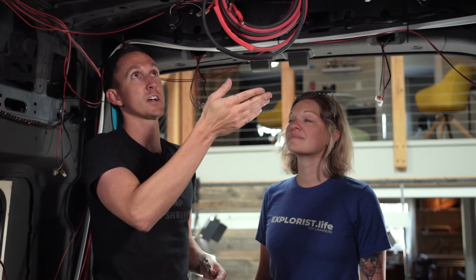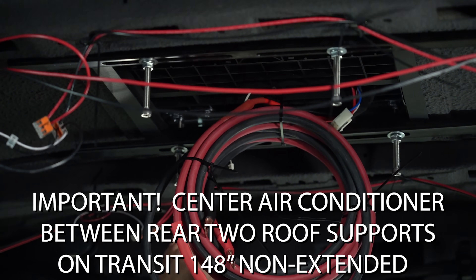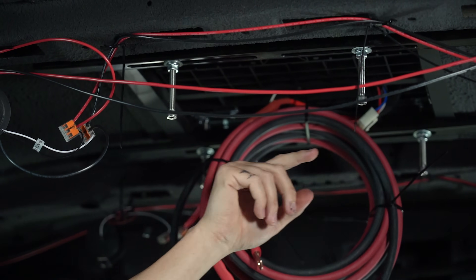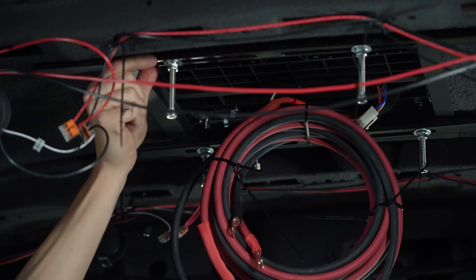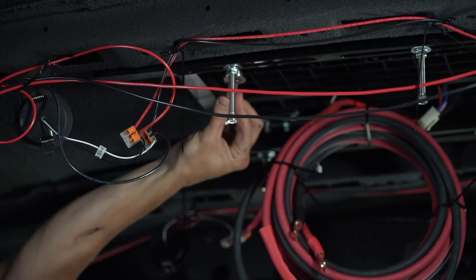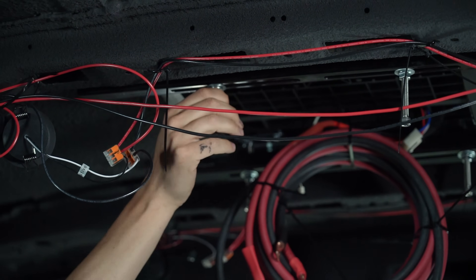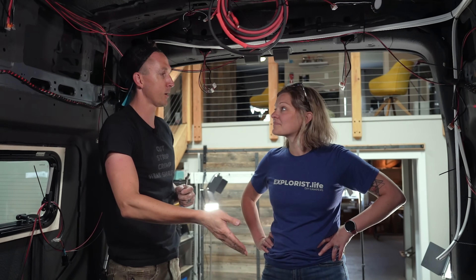We just wrapped up securing the air conditioner to the van. We have the flat metal plate that actually goes onto the body of the van, and we're going on the outsides of both of these body ribs here — actually capturing the body ribs for a little bit of extra support. The studs are threading into the plates on the bottom of the air conditioner, and these nuts are tightening up these cross braces. When tightening these, you don't want to tighten them too tight. I was just using my wrench with two fingers about halfway up to just snug it into place — you're just trying to compress the gasket. All these wires are going to be connected to the Lynx distributor later in the build, and the data cables will be connected whenever we do the walls.